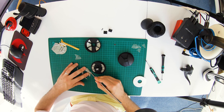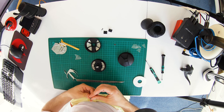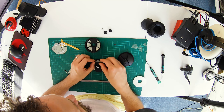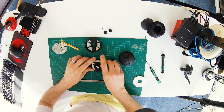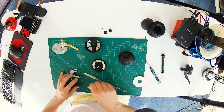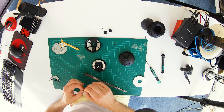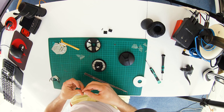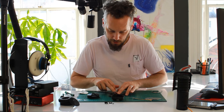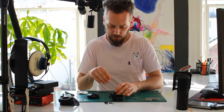Next we work on the actual driver itself. You'll notice two semi-circular pieces that are pre-marked and haven't been used yet. These go on the top and bottom of the driver as we're looking at it, damping the casing and the actual enclosure. This part probably has more of an effect — it has a dual purpose: you're damping the back of the enclosure, and these also press up against parts inside the casing, giving the driver something a little bit more to push against.